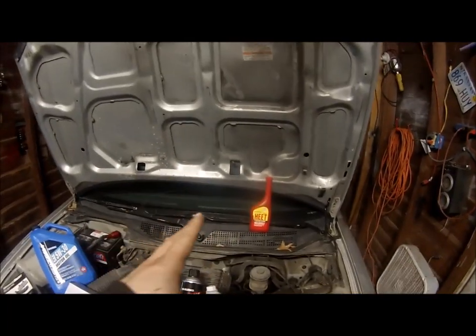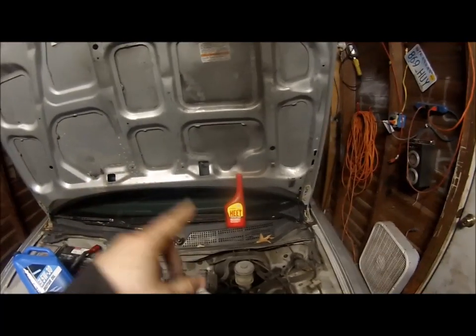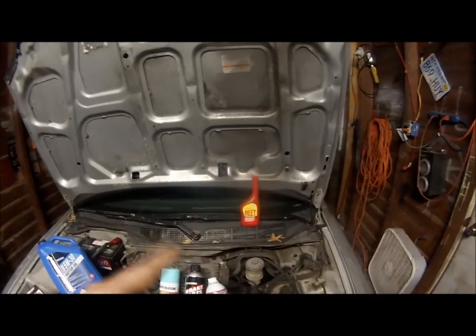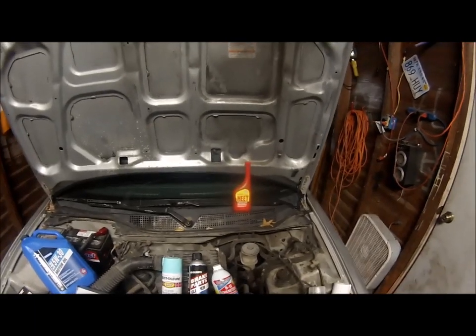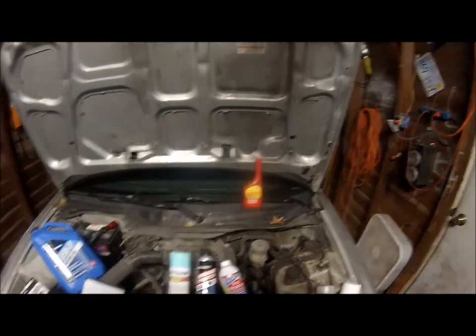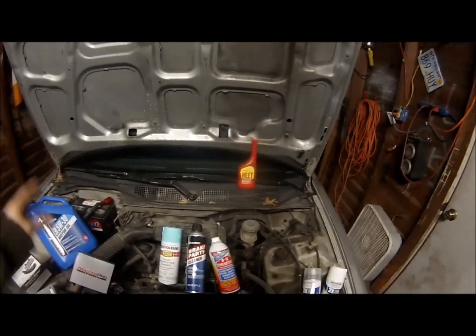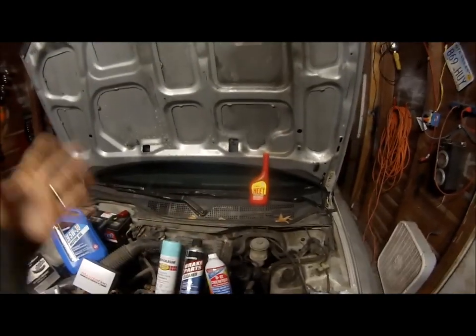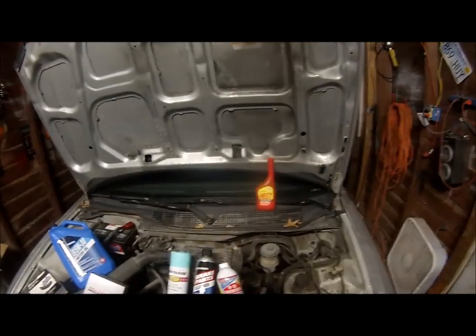ISO-HEET with injection cleaner. It's a water remover. It's basically antifreeze for your fuel. That stuff is highly recommended. It actually fixed one of the cars that recently I had over here. It had frozen fuel already and it was causing issues. And then I poured it in, let the engine reach operating temperature and let it idle for a while. And the heat from the engine cycled the fuel back into the tank and melted the ice. And then it hasn't froze over since. So get yourself some HEET.